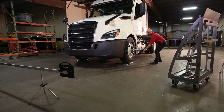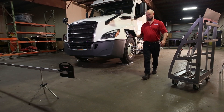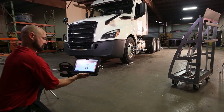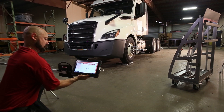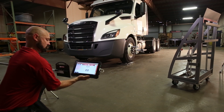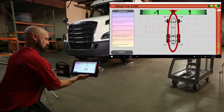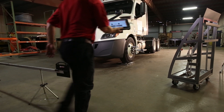The scale will appear for the front half of the vehicle. Again, using your thumb and fingers, move the front scale side to side with the bar on the software screen going from red to yellow to green and as close to zero as possible. When the red line appears in the center of the frame for the complete vehicle, front and back, press continue. From this point on, it is important not to move the reflector stands.